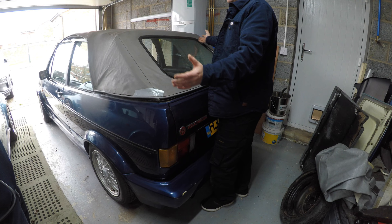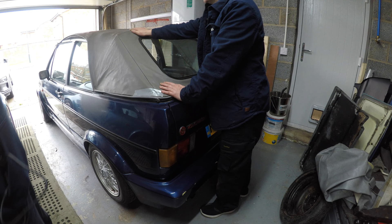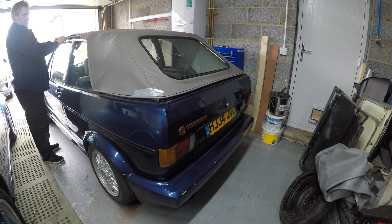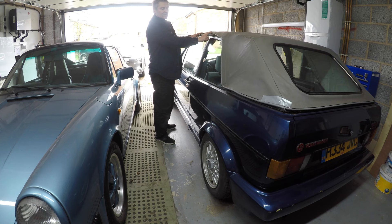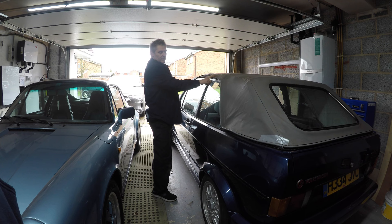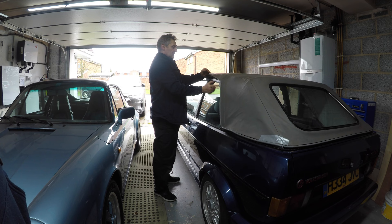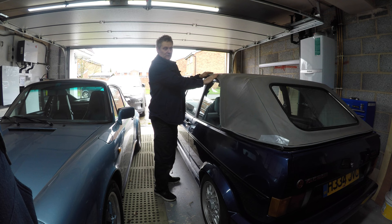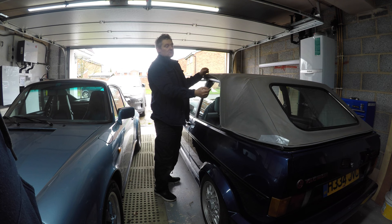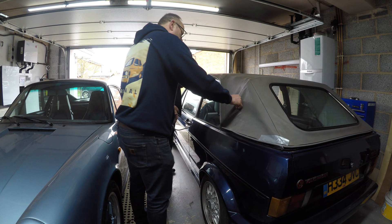Once they start to break down, moisture will seep through because the material becomes porous. The backing cotton sheet then shrinks, so what we end up with is this big frowning above the windows. Whenever you see a roof like this it's because the material has shrunk - this is the path of least resistance because your cable will run from here to a spring, the cable tends to pull and the spring will extend. I see so many times people saying you just need a new pair of side tension cables because they've snapped - in a lot of cases that isn't correct, so people will end up spending money on side tension cables when really what they need is a new hood.